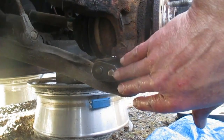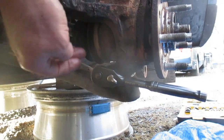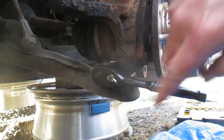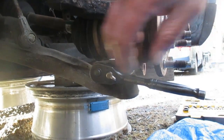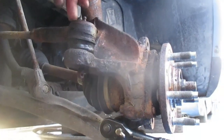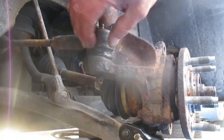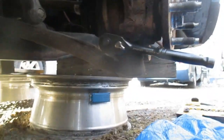I'm going to remove the pinch bolt on the lower ball joint. I have a ratchet on the other side, and this one is in place so that if it starts to turn, it should hit the knuckle and stop the nut from turning. I also put the tie rod end back in place temporarily just so the steering knuckle doesn't move around while I'm doing this.